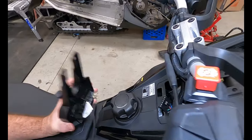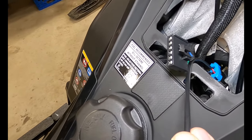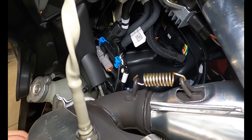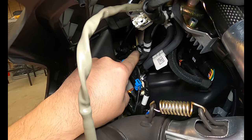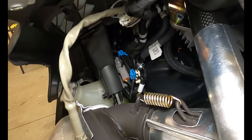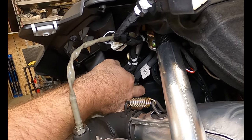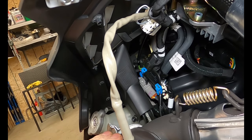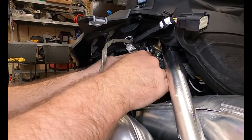Then when you come back over here, you're going to want to fish this end right in through the center there. You can see the blue end — push it down. There is a spot right here that's actually mounted and taped on to another one; it says RCA accessory power. So this is where we want to end up. Get in there — it's just a clip, pop it. You can see right there where the plug has come out; you can see the green.